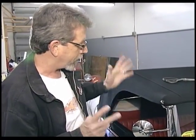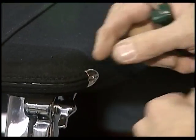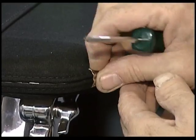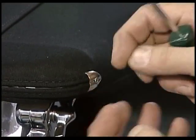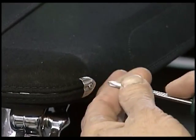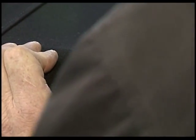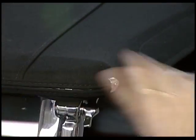I have a couple tips at the end, and we're all done. The hide-em is sometimes just a touch bigger than the trim area — run it down part way, tuck all your hide-em ends in behind your chrome trim, then tighten it up. Trim's on. Those of you with a non-removable rear curtain top — the top's finished.